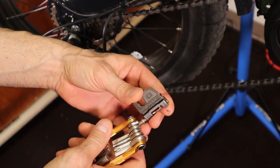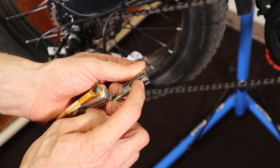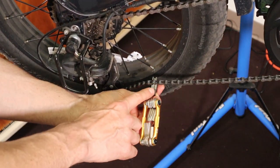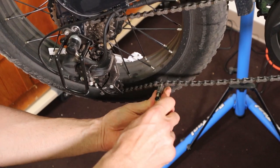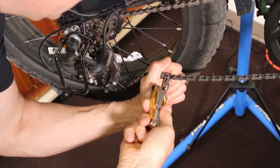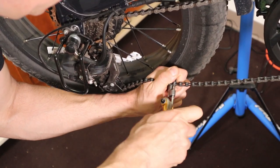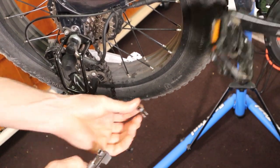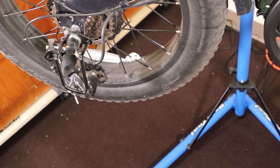I use this one off the Crank Brothers. Just open this back up a little bit and then the chain is going to slot down right onto these little prongs right here. Go ahead and slot this onto your chain — what this is going to do is push one of the pins out as you screw it in. Just go ahead and crank that down and start pushing that pin out, screw it in all the way and it's just going to pop that pin right out. Then unscrew it and the chain just comes right off. Take that all the way out, pull your chain completely out, and just set your chain aside for now.